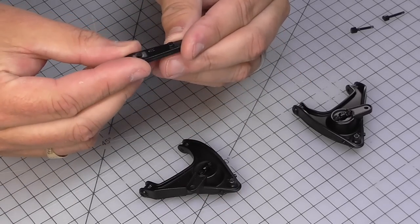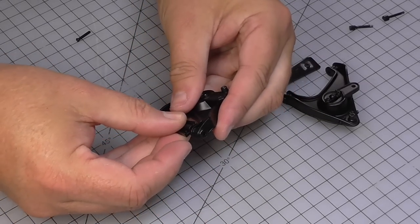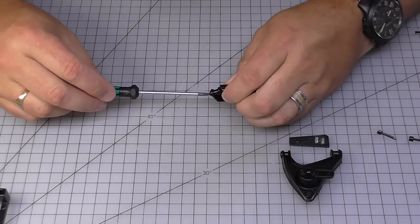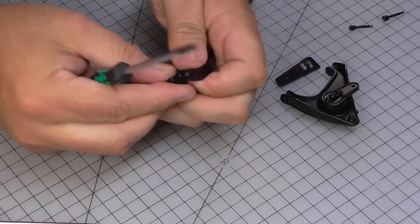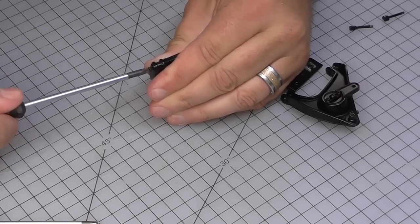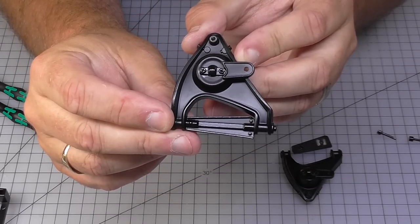We need to match up the control arms. This one's stamped with an R, so I'm going to need the R shaft that looks like this. The left side is going over here and I'm going to be putting it in this way, into the gap just there, held in with KM screws - these are very long screws. I'll put these into some oil and ensure it's going into the shaft at the other side. I'm using my bigger screwdriver for this just to help it out, then another KM screw through the other side. Oil is definitely your friend here. When it's in it should look just like that - doing the same on the other control arm and there you go, both are in place.